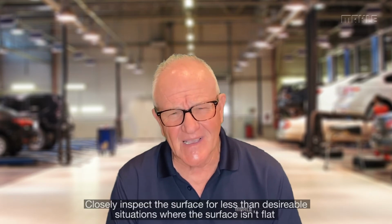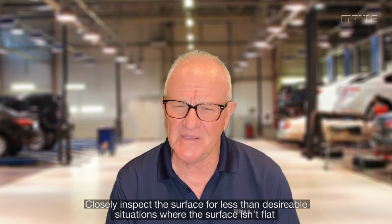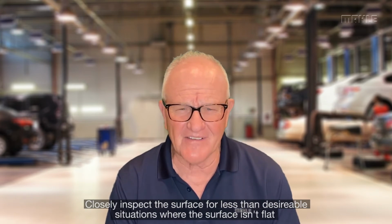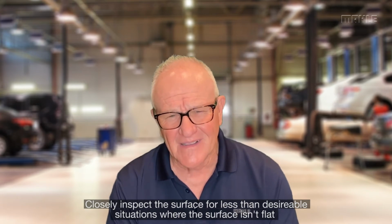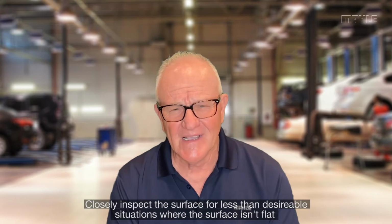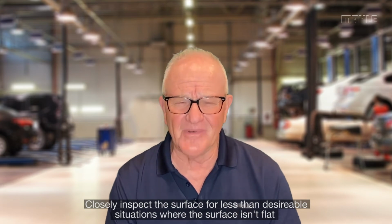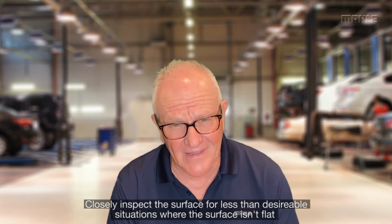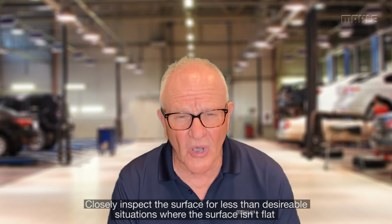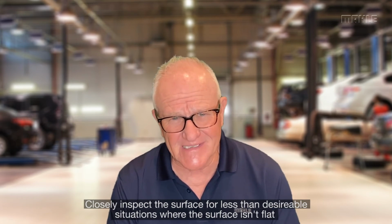The other thing that you really need to take a look at when you carefully remove the cylinder head is the surfaces. Now, gaskets are pretty lenient, but you really can't have deep scratches in there. You really can't have people sand and grind away the combustion seal, especially on engine decks, where you'll have that carbon ridge and they just can't help themselves, so they grind that off. So now the finish is less than desirable, and it isn't flat, so there's no load for the new head gasket to seal. So you've added insult to injury in this case.